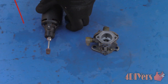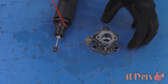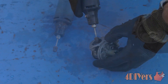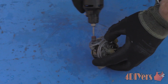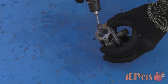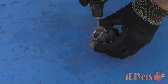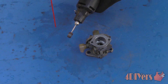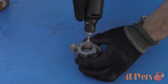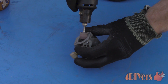This next step doesn't apply to all carburetors as it will depend on how your air filter side is designed. With this particular setup I am able to flare out the opening to allow more airflow. Safety glasses are needed for this process. Use a rotary tool such as a Dremel with a coarser stone — this will cut back the aluminum material fairly fast. Since this is aluminum it will plug up the stone quickly, so we need some form of cutting or penetrating oil to keep the stone clean. Work at a moderate speed so the oil doesn't spray everywhere. Wipe away any excessive material buildup and keep applying the oil as needed. Once satisfied with the flared opening, wipe it down and then move on to an 80 grit drum sander. Since we can't wet the surface, I would highly recommend wearing a mask.